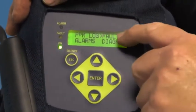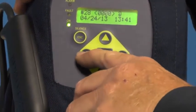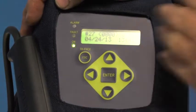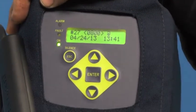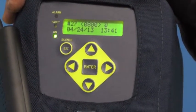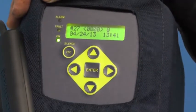Once I've moved the arrow over to Faults, I hit Enter — that gives me the fault screen. I push the back arrow and I can see the last fault, which is an 0800. 0800 indicates that the wand, tube, or filter has become clogged with dirt or debris. So I know immediately what my last problem was. If my purge filter on the front is clogged, it would be an 0100. Being fully self-diagnostic, it gives me a handle on exactly what problems I might encounter.